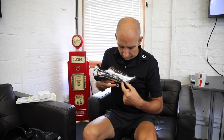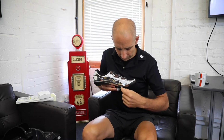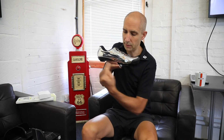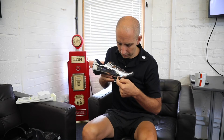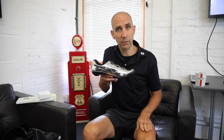Well, the idea is that if you imagine that you're riding, say, 170 cranks, and then you manage to get your foot maybe 20 to 30 mil further in front of the point when the crank is at the 3 o'clock position, you get a lot more leverage. So in effect, the sole of the shoe acts like a virtual crank. So it's extending the length of the crank when it's in the horizontal plane. Absolutely. As it is sat there at the moment.